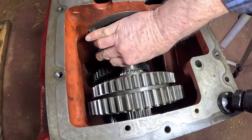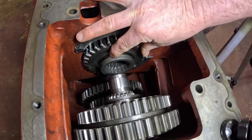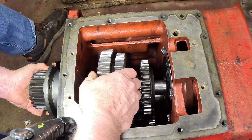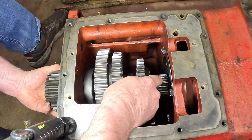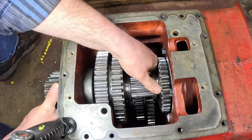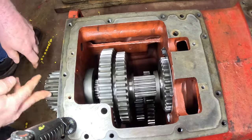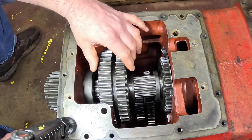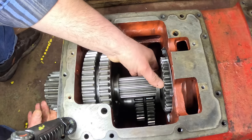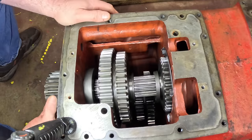Except when this front gear is engaged with the quill gear - the shifting fork in this collar will push that in, and that's direct drive right through there. These two gears on the main shaft both have shift collars that the forks go into, so you slide them back and forth to engage whatever gear you select. With that gear out and that gear over there, you're in direct drive.